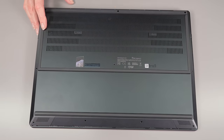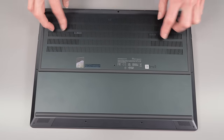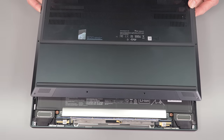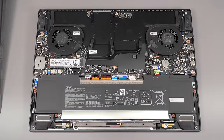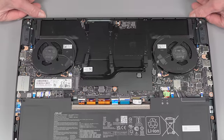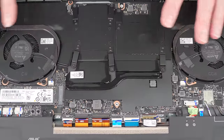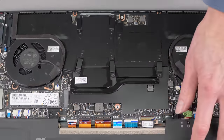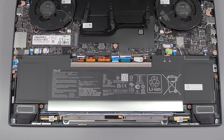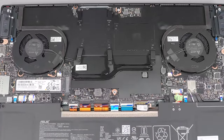To get inside you need Torx T4 screws — not T5 — easy enough. The ventilation is partially open where the fans are. Once you undo those screws the back cover just comes right off — no wrestling with plastic clips. Inside there's a little less user-serviceability than a typical mobile workstation or gaming laptop. Notably the RAM is soldered on. There's vapor chamber cooling and liquid metal, dual-fan cooling, the large 96Wh battery, and a six-driver speaker system with woofers firing downward. The Wi-Fi card is also soldered on, so it's less upgradable than usual for this class.